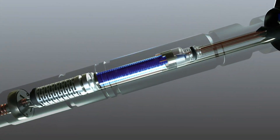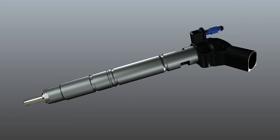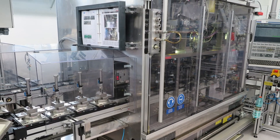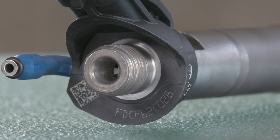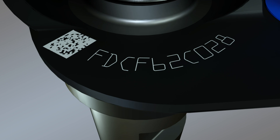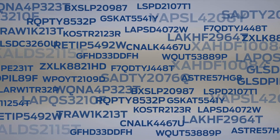More injections in a shorter period of time means as many as five injections per power stroke. Each injector's flow performance is unique. During assembly, injectors are tested to accurately measure their individual fuel injection quantity. Then the injector is assigned an IQA code, which we mentioned earlier. The IQA is a fuel flow trim code, a compensation value that provides the precise, accurate fuel quantity needed from that injector. There are potentially trillions of exclusive codes.